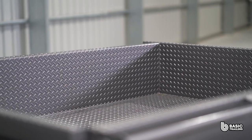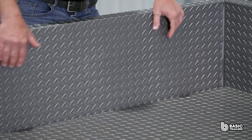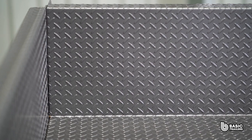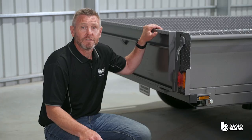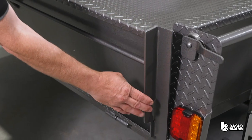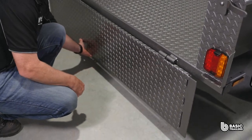The body of this trailer is designed with 2.1mm checker plate with 350mm sides on each side. We chose to break tradition and fold our sides instead of welding, ensuring protection against the risk of rust. Behind the trailer, the precision of the laser cut 5mm tailgate end plates is clear, with the number plate light slot custom designed to allow for a full 180 degree tailgate rotation.